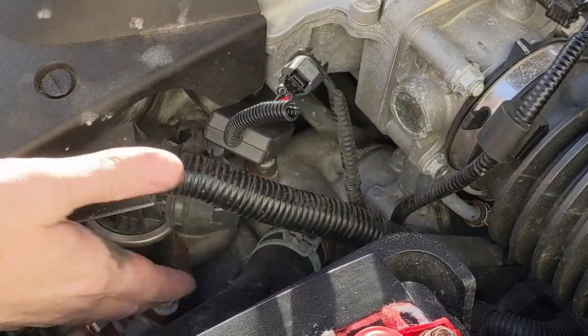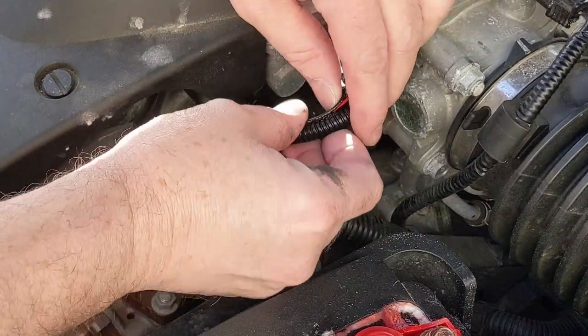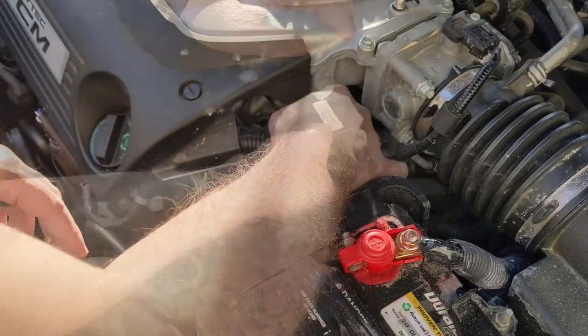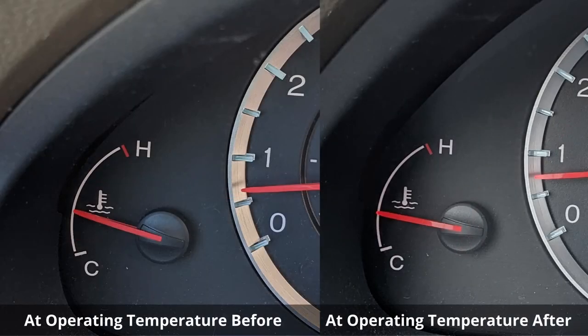I'm going to try to get out of the way so you can see me on camera with my fingertips — plug this up, yeah it snapped on there. Hopefully you can see that — it just snaps right back on the ECT1 sensor. I did not have to remove the engine shroud or cover on mine, but some models may have to. My wire protector here needs to be taped on — I'll get that later when I install this permanently. I'm just going to push this down out of the way for now, but I do want to make sure the label is up so you can tell what that little box is. Now after making a trip with the car and getting it up to normal operating temperature with the 82 ohm resistor, the gauge is reading a gauge needle thickness below where it used to be.